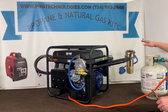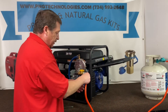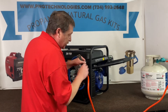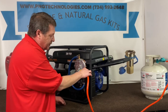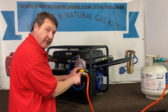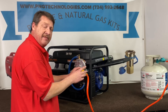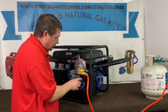We're going to hook this up to a propane tank. The propane side will come with all the regulator — you've got your POL connection, and on the other side you'll have your flare connection. When you want to run natural gas, you'll just eliminate the bushing and fitting here and take your natural gas line directly to the ball valve. We carry true three-quarter inch quick connects orificed for running a combustible engine — different than quick connects for grills or furnaces, which won't give you enough volume.